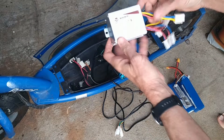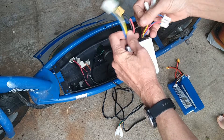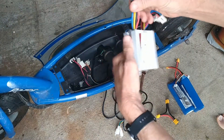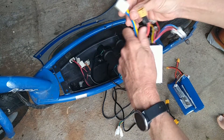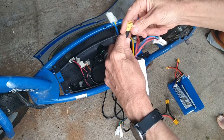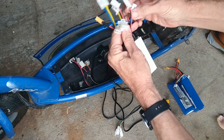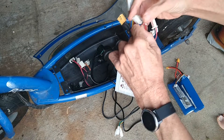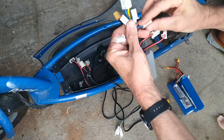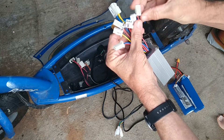So here's the new gear that I bought. First of all I bought a 36-volt, 500-watt controller, and it's got all these cables coming out which look a bit worrying, but basically the two pairs of thick cables — one's for the battery, one's for the motor. For the battery I put an XT60 connector cable on, because the batteries I'm buying come with an XT60 connector. All the other thinner wires I've labeled: lock, which is basically the on-off switch; brake; brake light — I probably won't use that; the throttle; indicator light; and charge port.